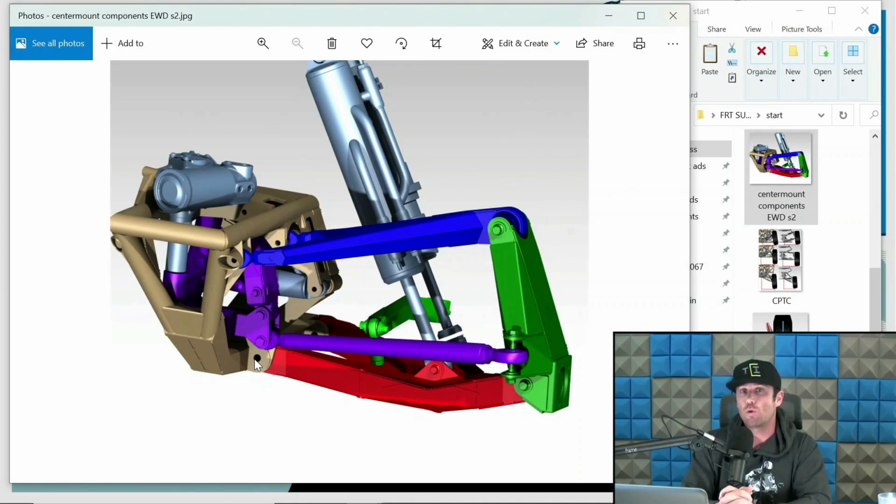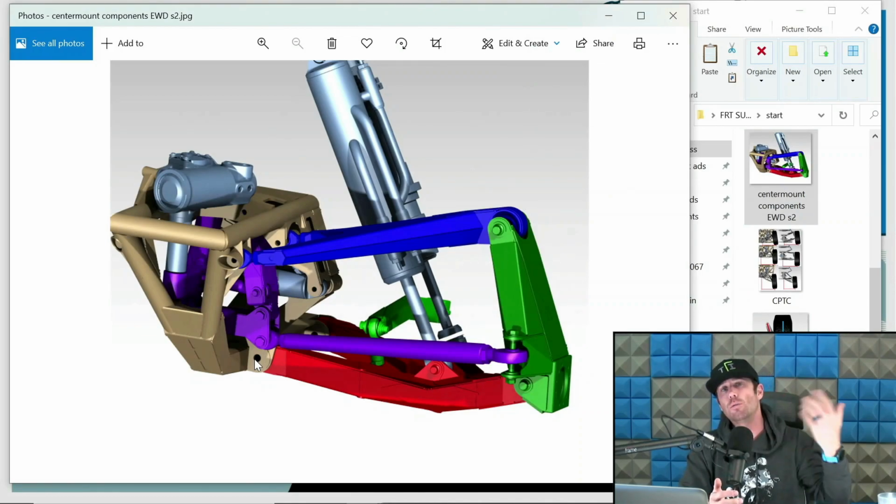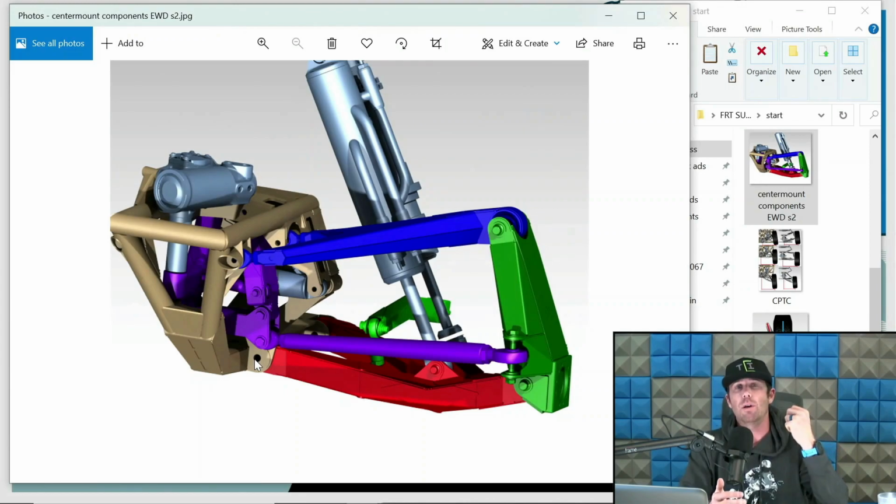And with that travel, we can control it appropriately because, like I was just saying, I get to pick where all of the points go. And in doing so, I create the geometry. The designer creates the geometry, and we can work with a blank slate. That is completely different than working on long travel-based setups where you're working around stock suspension, and that can become a total nightmare. So, with that said, blue is our upper arm, green is our upright, red is our lower arm.